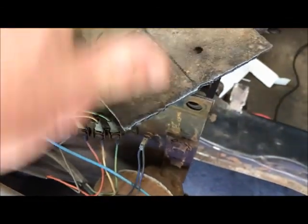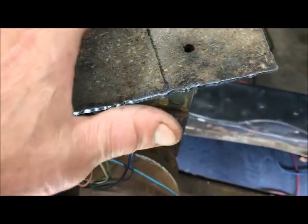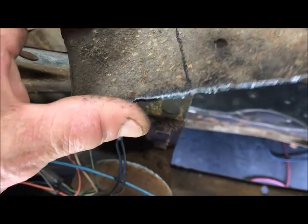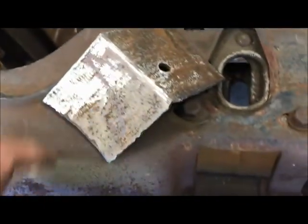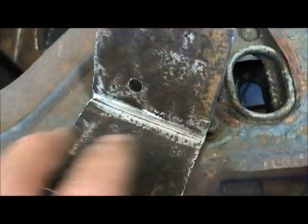There's the top plate - just making sure it fits in between there. The line is a bend line where one half is gonna have to bend downward. This is pretty heavy plate and my only bender is for sheet metal, so what I'm gonna do is score it with the cutoff wheel maybe halfway through, put it in a vise, and bend it over. There's the high-tech bracket ready to go - weld a bead on the inside where I made the cut to bend it, set it in there and burn it in. One side done, one side to go.